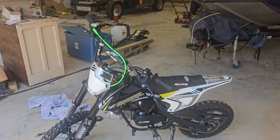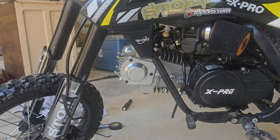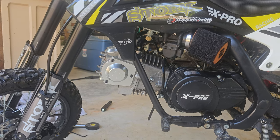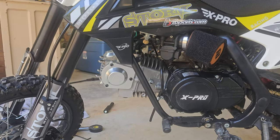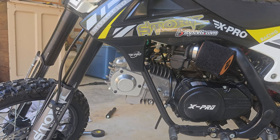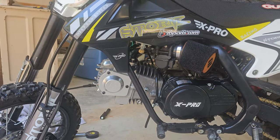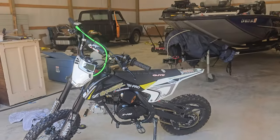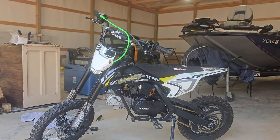We were kind of worried because the cylinder itself is about 2 millimeters longer with the gaskets than the factory one. And so, you know, that's why the timing chain was harder to put on. And also, we were kind of worried that it wasn't going to have enough compression. But we finally got it to pick up and crank. So it could run, you know, might be bad to the bone. But we're not going to know until we get this break-in procedure done all the way.